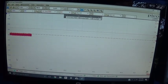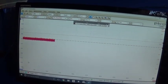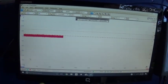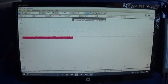At the beginning of the video, I said that this system is similar to NVLD, which it is, and I said it doesn't have a purge valve. That was wrong. Of course it has a purge valve, but it does not have a vent valve.